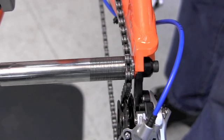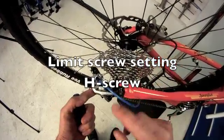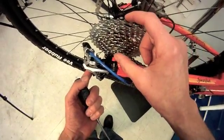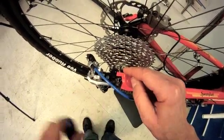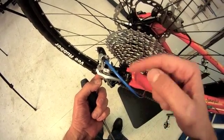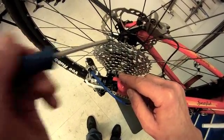So let's now try it with the rear wheel in place. We have our gears in place. Let's discuss the adjustment of the rear derailleur. We want that guide pulley — the upper pulley — to stop in two positions. We want it to stop all the way out on the outermost — that's our high gear. The H screw will control the outer motion, the stopping of the derailleur in the outermost position. The innermost is controlled by the L screw, our lowest gear — L for low.